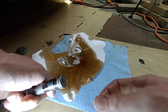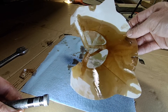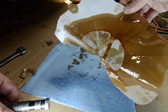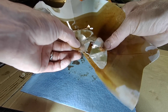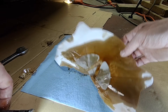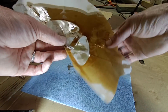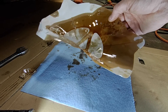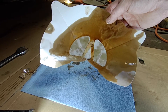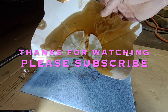So I'm not really too concerned about that. There you go — that's how you do a budget at-home oil analysis, and you can see you can get some pretty concrete results, especially when you involve the magnet to determine what the metal particles are from. If it was steel — like bearing material, ring material, or anything like that — it should stick to that magnet. I do hope you found this video helpful and informative. Thanks a lot for watching Matt's Garage, don't forget to like and subscribe, and have yourself a great day.